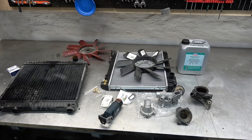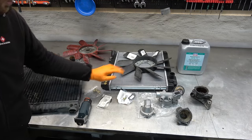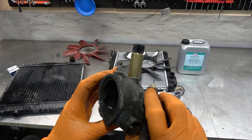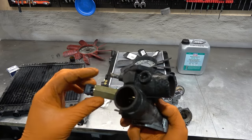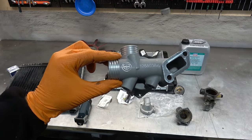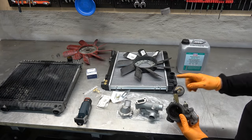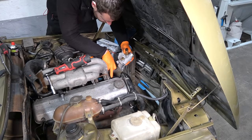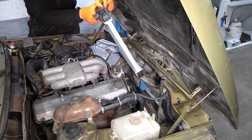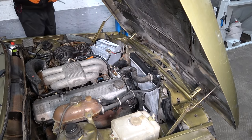Here's everything on the table — the old radiator is just full of rust inside, completely gone. Here's the new one, new fan blade, thermostat housing. The old thermostat housing is missing part of the pipe and disgusting inside — eaten off — I'm quite surprised it didn't leak. This is the beautiful new one with an engraved logo. Expensive but necessary. Now reconnecting everything and refilling the coolant — bubbles coming out of the bleed screw on the thermostat housing.